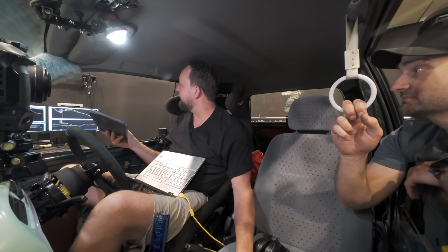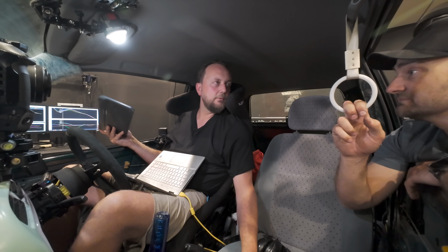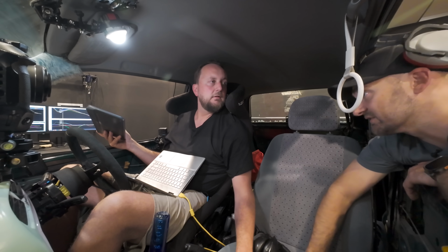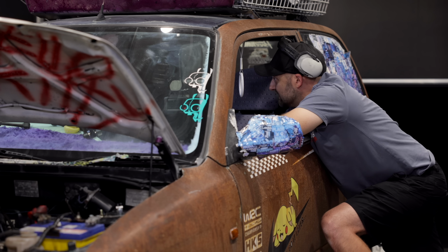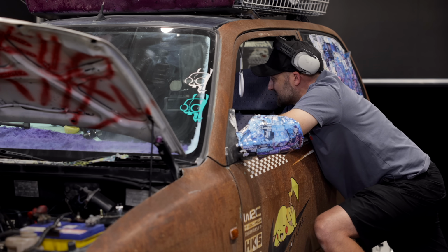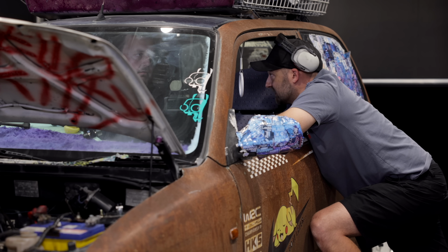We're looking pretty good. The torque curve is just dead flat. You press the button, it makes 30 kilowatts at the wheels. Yep. Love it. Which is about right. Without a turbo, without ethanol, without any breathing mods, and with a basic exhaust system, that's what I would expect. So we're in the ballpark with a fresh engine, man. It's healthy, there's no smoke, there's nothing leaking out of it. This should be good to just thrash all day long, which is what I want.